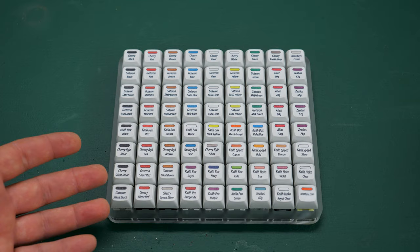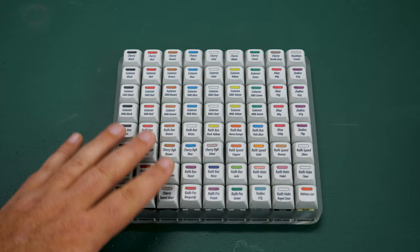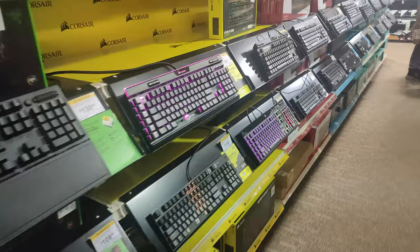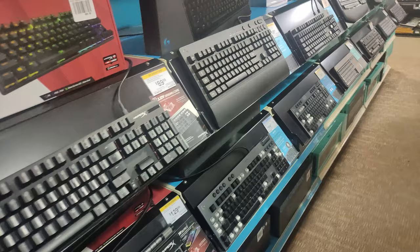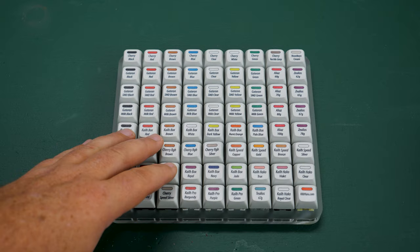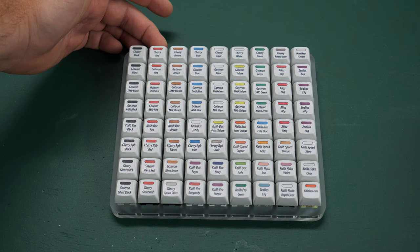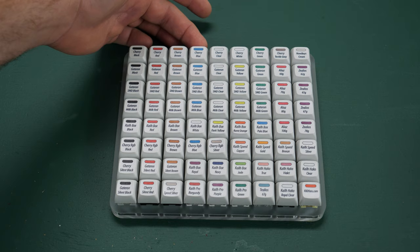It's really hard to figure out what style of key switch you want when you don't have access to all of them — there are hundreds of different types. You can go to the store and try out keyboards; I recently went to Micro Center while on vacation and they have a whole aisle dedicated to mechanical keyboards. Typically you'll find three different styles available off the shelf: red type switches, brown type switches, or blue type switches — relating to linear, tactile, and clicky.